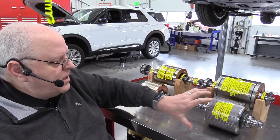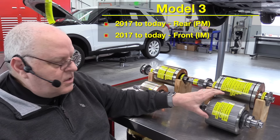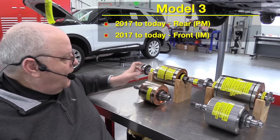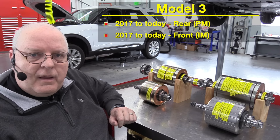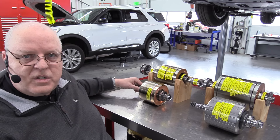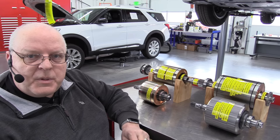So those are the different combinations — these three rotors right here for the Model S and X. Now if you get a Model 3, the rear motor has a permanent magnet rotor, and I'll have a different video on that coming up. In the front, you have a much smaller than the Model S induction motor. I don't know what they did in the Model Y yet. From what I've read and seen, it's the same in the rear, and in the front it just has a different rotor design that uses an aluminum core instead of copper. But I need to get more information on that.